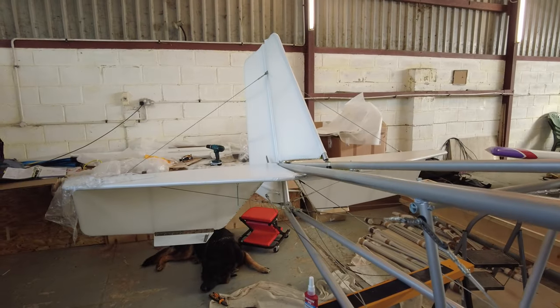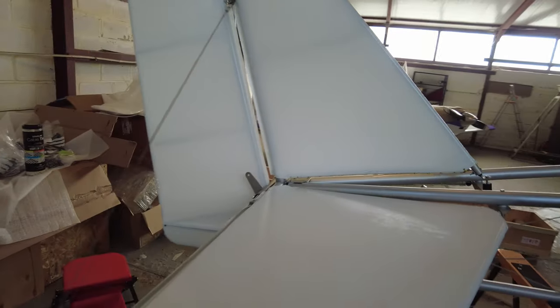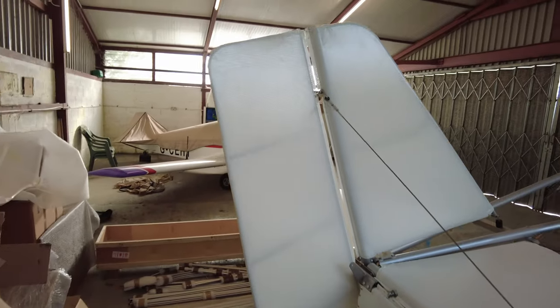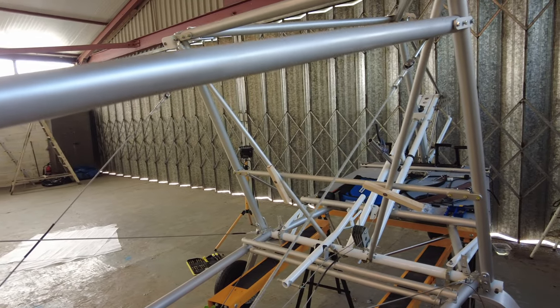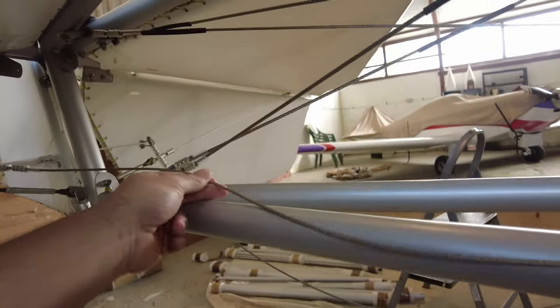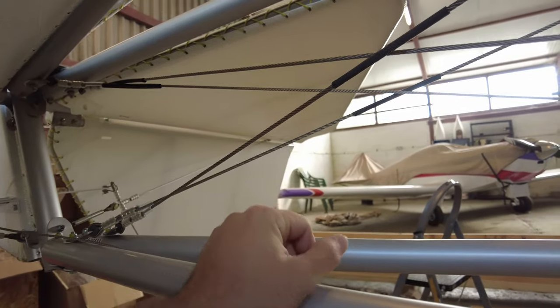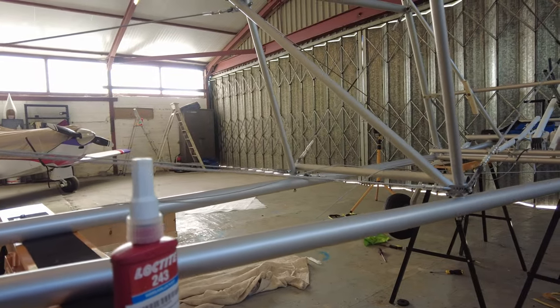Last night I finished the tail plane. We've got the horizontal and vertical stabilizers all installed now, the support bracing cables are in, and we've got a nice free-moving rudder. Our next job is to hook up the control cables. I made a very brief start with the rudder cables, just hooked those up loosely. Now it's time to run the elevator cables through, which I'm just about to start.